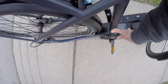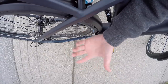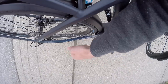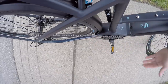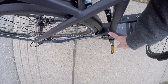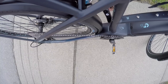Getting ready to take off — you can see the 38-tooth chainring with an FSA alloy guard that protects pants and acts as a chain guide. In the rear, it's an 11 to 42-tooth cassette — a great range for a city bike, more commonly seen on mountain bikes. It's Shimano Deore with a one-way clutch so it tightens up or can be put to service mode to make the quick release easier. There's a plastic slap guard on the chainstay and on the base of the down tube. Using the highest level of assist — the cool thing about the Active Line Plus motor is you can pedal backwards to do drivetrain service, something you couldn't do on the Performance Line motors.